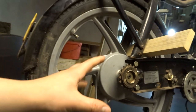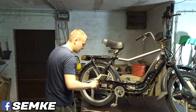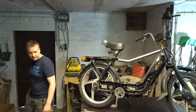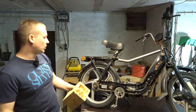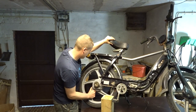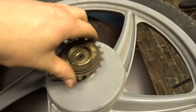To disassemble the whole brake system you have to take off this piece, put a block of wood between the spokes and the frame — I already loosened it — and then you can just loosen that up. I wish I knew that before. I'm going to leave the assembly loosely on so the whole thing doesn't fall out, then take the piece of wood out. I remember the holes from last time, so the block can go right in here.